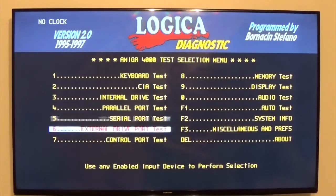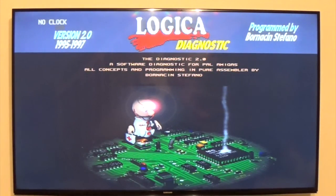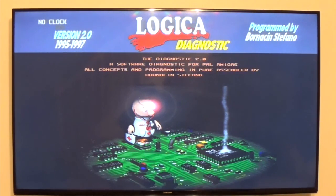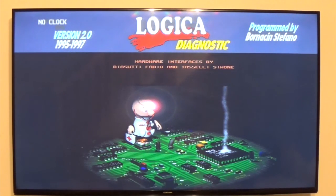The about screen says Diagnostic 2, software diagnostics for PAL Amigas, all concepts and programming in pure assembly. In a nutshell, that is it — you can go deeper into the boot sequence in hardware to look at what fails if your machine won't boot. It will also do looping tests of everything: RAM, sound, video, whatever. The only thing missing is an IDE or SCSI test — there aren't any, which is surprising for a 4000.